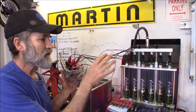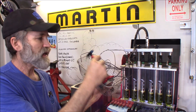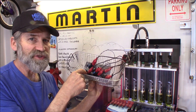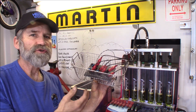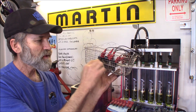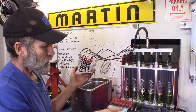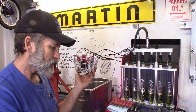What we're going to do next is take the tester over here and hook up all the injectors. I got this little aluminum tray that sits in the basket — that way the injectors aren't submerged under the fluid, but they do come up to this level here. We're going to turn this thing on — number one, ultrasonic testing.